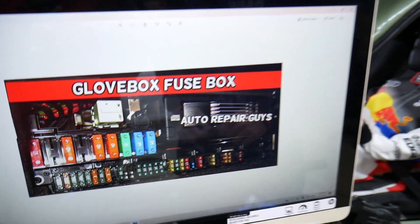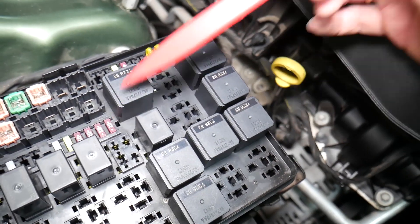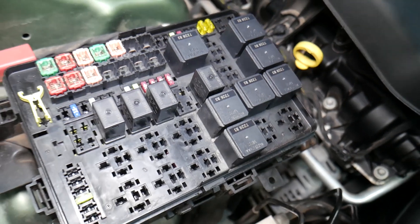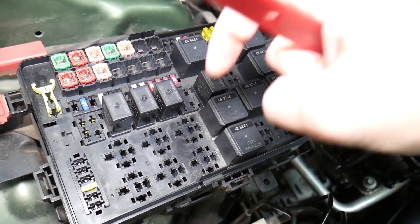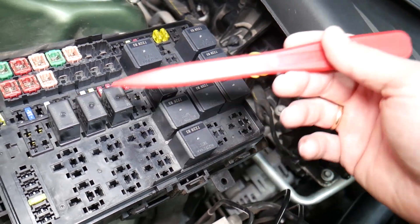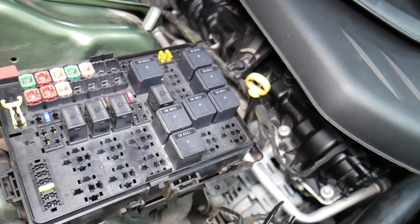Before we continue, let's explain why it's important to test fuses and relays. It is super important to always test fuses and relays — and here's a common mistake people make: sometimes you may think a fuse is good, or you cannot actually see if it's clearly burned. In that case, you may put the fuse back and end up spending money and time on parts you don't need. All you have to do is test the fuse — we'll put a link in the description on how to test fuses and relays. It only takes a few seconds to find out for sure if it's good or bad. Also, for some fuses it's important to disconnect the car battery when removing them, otherwise you can burn the electronics.